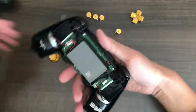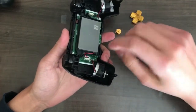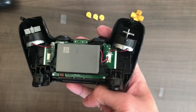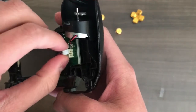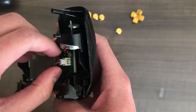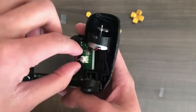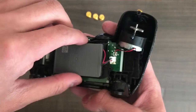The next step is to unplug the battery pack. To do this, you actually need to squeeze it and then pull upward. So I finally managed to pull the battery out. It's actually a really small piece. So if you have really fat fingers, it's going to be hard for you to grab a hold of it. What I basically did, I used my left hand — there was the most opening if you use your left — and I basically pinched as hard as I can onto these two sides here, and I just yanked upward, and eventually it came out.